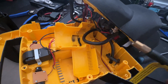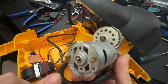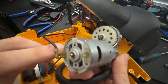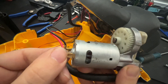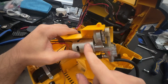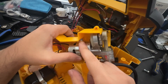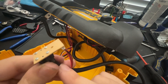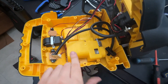We are going to start by first routing the hose of the new compressor through the hole that we took the old compressor's hose from. We will then connect the leads to the new compressor — they are color-coded. Over here we have a dark dot, and down here we have a red dot. These leads simply click into place, and then we will mount it in the plastic in the same orientation from which it was released. You can realign this metal bracket and screw it into place making sure it's secure. We can attach this harness to the board we removed it from earlier, then orient the back cover and put all five screws back into place.